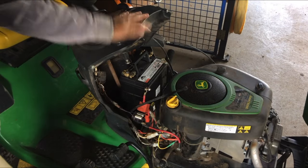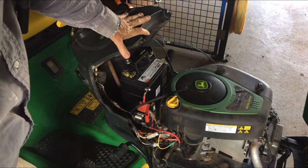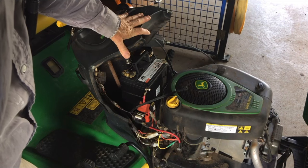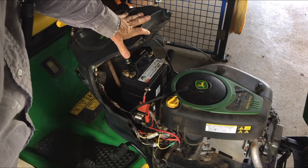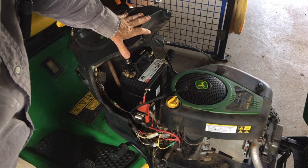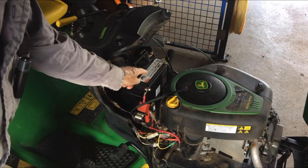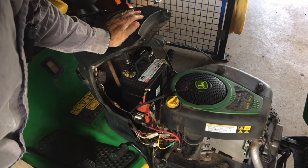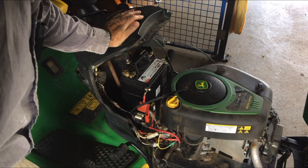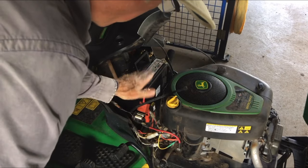It's the next day. I ended up taking the original battery into my battery shop to give it a test. When I got there they put a multimeter on it - same as what I did - and they only got about 10 volts. So the car ride from here to there must have completed the damage. I think there was a cell collapsing inside the battery and it wasn't making a proper connection - that's why I was getting 12 volts but not the full amps out of the terminals.